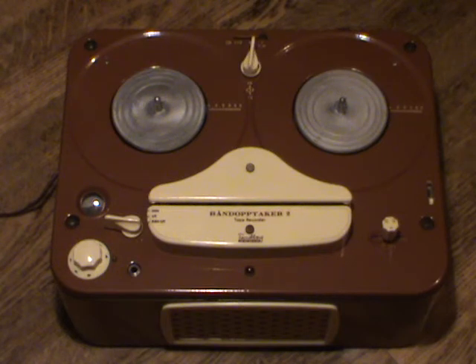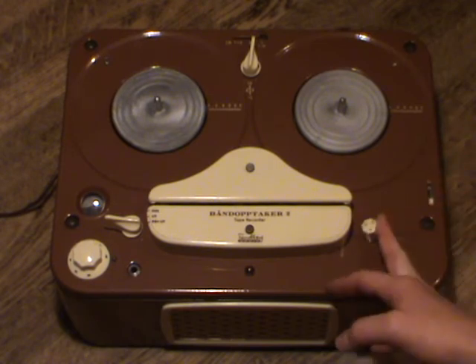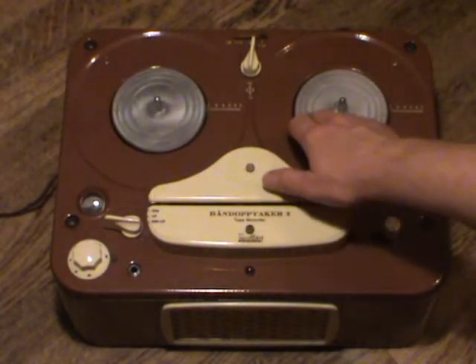The design itself was, if not copied, then very heavily influenced by the later American versions of the Sound Mirror tape recorder from the Brush Development Company. It has a joystick control which is very simple and intuitive — fast wind to the left, fast wind to the right, and playback by pulling it forward. The Sound Mirror had the playback position in the other direction, but that was the basic idea. This machine also has a figure-eight belt running between the reel holders with the motor in the middle, which is also a Sound Mirror design feature.